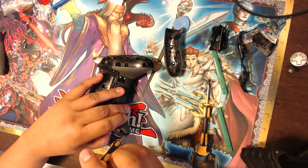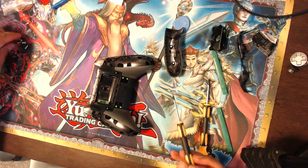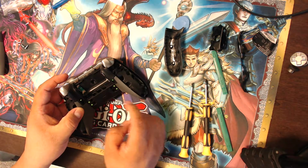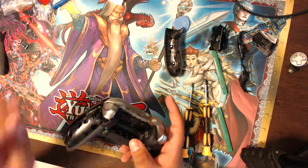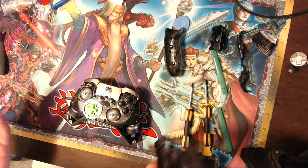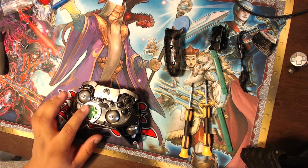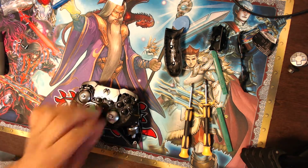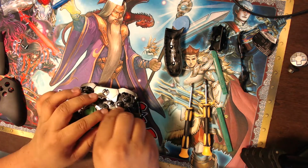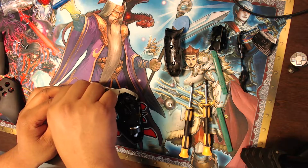And then from the YouTube videos, they say it's pretty easy. All you do is take the plastic out of the back, pull the bolt out of that, pull the bolts out of these 4 ends, which I have done. And now what they say is the plate comes off, which it does, and it looks like it holds the whole components together pretty easily. And what they also say you should do is take off these little gaming pads, because they can fall off and you don't want to lose them. So I'm going to take that off there.